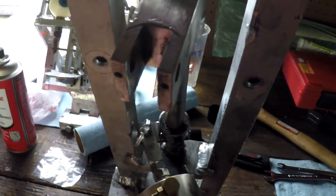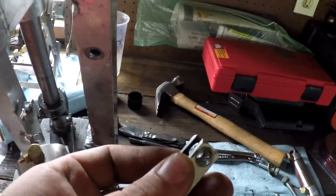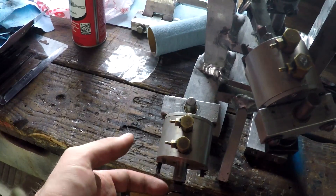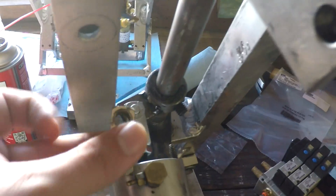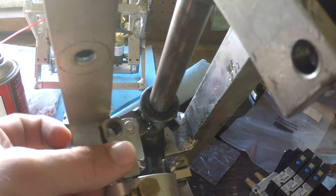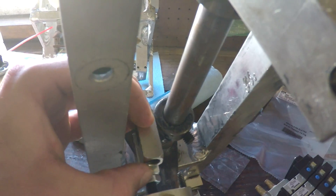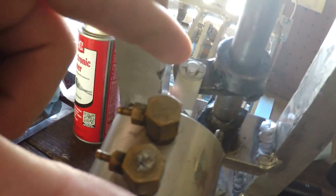I just need to make adjustments so that this will be perfectly straight when both actuators are closed. Before that, I'm going to try to order these rod ends, because this one in particular is very walled out and when I screw it on it's kind of crooked. Ordering the rod ends was difficult because they go by a yoke size I really don't understand, but I found a website with measurements and was able to order them. As you can see, the new rod end was a little shorter than the original, but luckily it doesn't matter — when I accounted for both sides, it equaled out. When both actuators are closed, the head turn is perfectly straight. When one extends it turns right, and when the other extends it turns left.